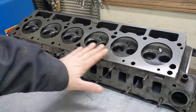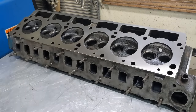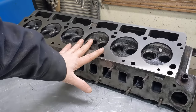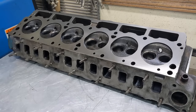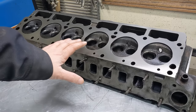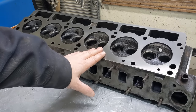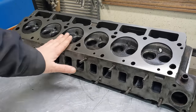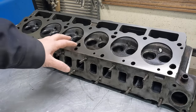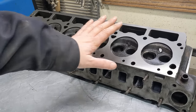Because this head had blown its head gasket in several places, I took it over to the machine shop and had them true up this mating surface. I don't have the capability in-house to do something this wide, at least not as flat as I want this to be.